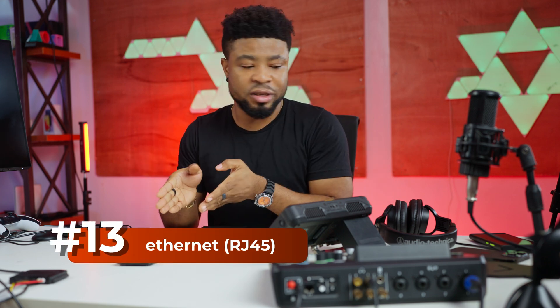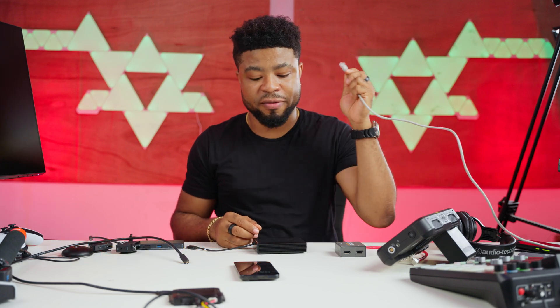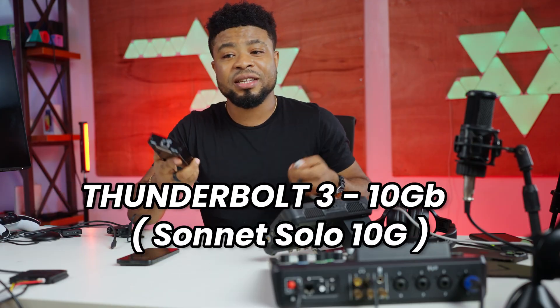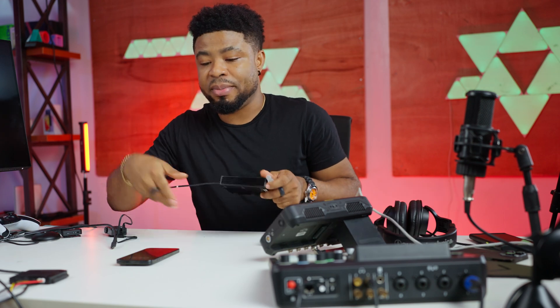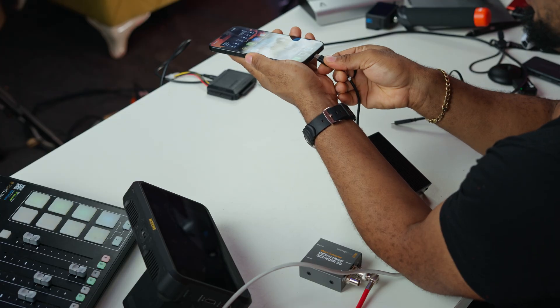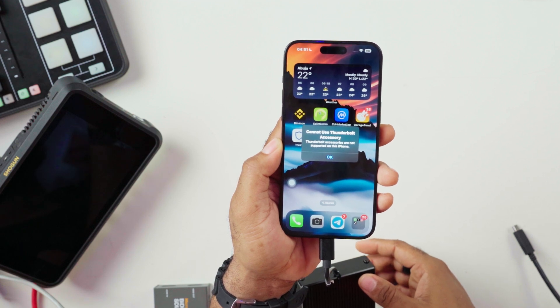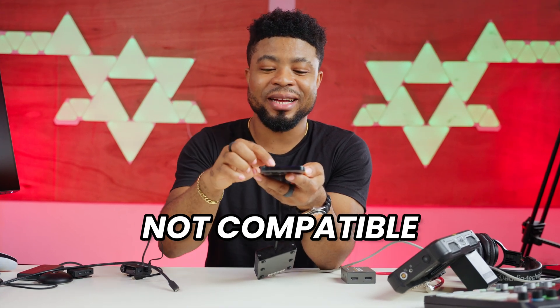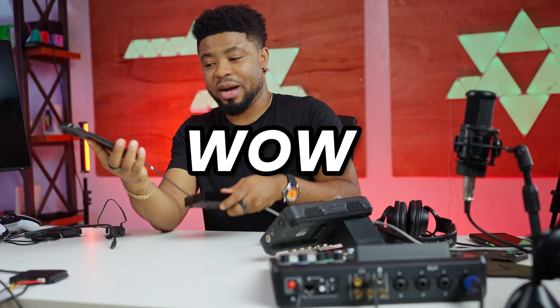Having USB-C on a smartphone like this means you can plug in a lot of accessories. I'm going to test out an Ethernet connection. To connect RJ45 to your iPhone you need a USB-C converter. I'm using a Thunderbolt to 10 gigabit converter, but the iPhone says: 'Cannot use Thunderbolt accessory — Thunderbolt accessories are not supported on this iPhone.' So you can't use Thunderbolt accessories on the iPhone 15 Pro. However, a regular 1-gigabit converter should work.